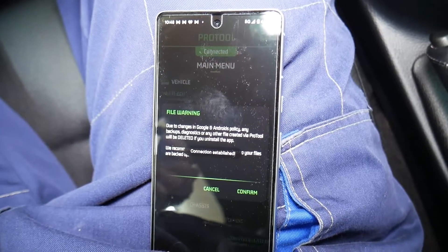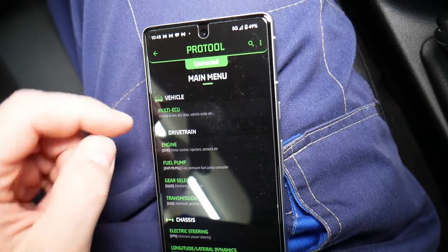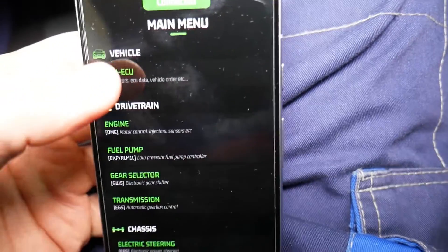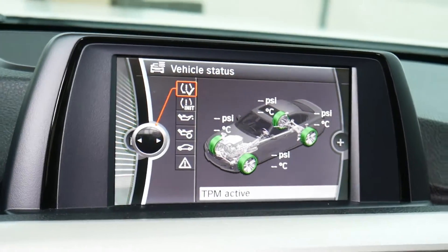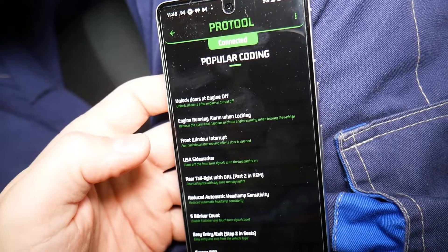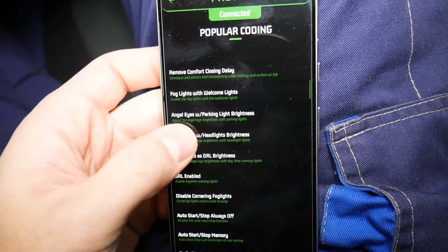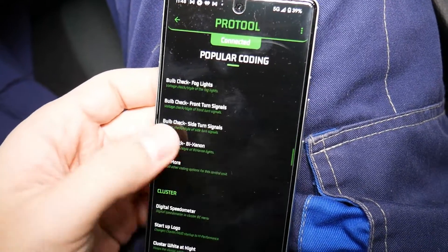It's finishing up — things may start dinging in the car. Now confirm. You have all the different computers available here now. We're going to go to 'Multi ECU' and click Coding. A few things you can also do here that are super nice: one is the coolant temperature gauge right here, you can check your tire pressure — actual pressure and temperature as well. We'll have videos on the channel on how to do that. Now we're going to scroll down until you see the function: 'Legal Disclaimer — Remove Legal Disclaimer.'